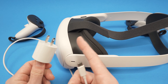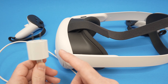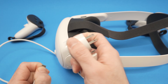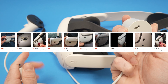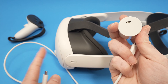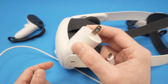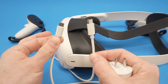If you do not have the original adapter, I suggest you get one that is 18 watts or less. Some people had trouble with the Quest 2 charging with other types of adapters that were a lot more powerful — their power port melted. This is not happening to everyone, but I just don't want you to damage your Quest, so it's better not to take any risk. You can also try using another USB Type-C cable in case that was the issue.